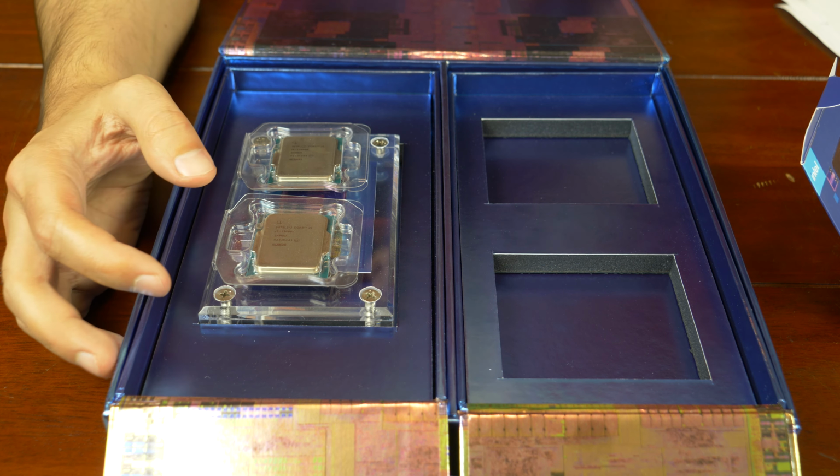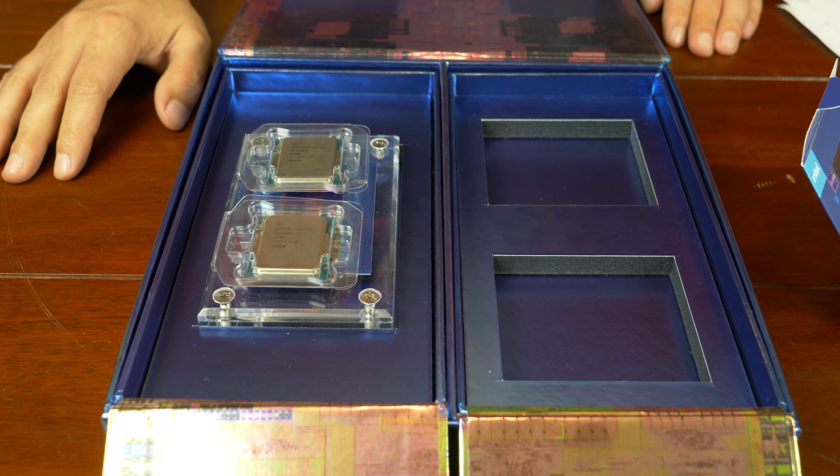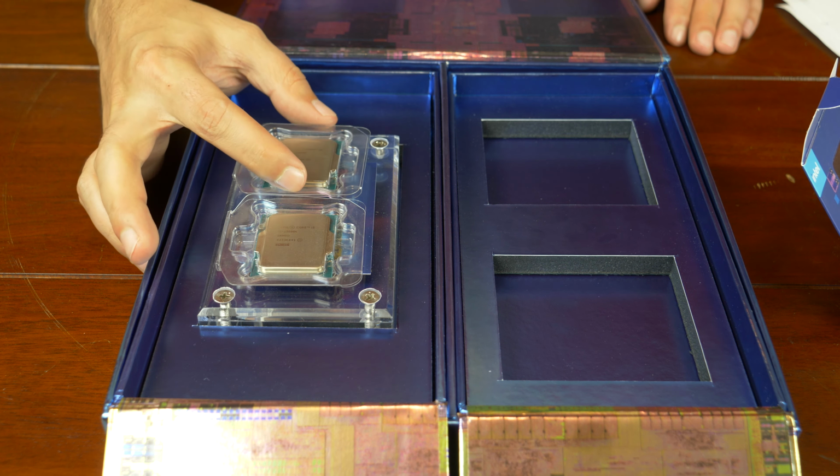Now let's talk TDPs. TDPs, all the hype today. These CPUs, as well as the previous CPUs, have very high operating temperature maximums. 95, I think. Thermal junction temperature, which is called TJ or TJ max, is basically, I believe, 100 degrees on these CPUs. This one will run hot. This will hit up to like 95. This one will not. This one has a lot more OC headroom than this one. This one has been tuned to its maximum.